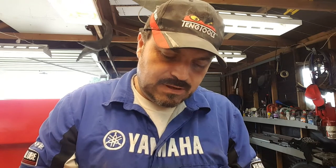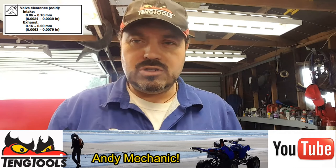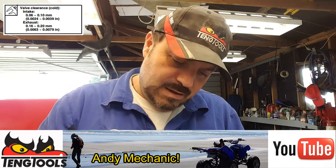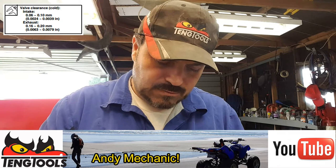And to use a standard feeler gauge, it isn't gonna happen. I think you saw me use these on the Yamaha Viking engine rebuild a few months ago. So I'm gonna set the clearance to what I call maximum spec, which is gonna be 0.1 because over time that clearance is gonna shrink down. So if we look on here, we have got, good old Yamaha, exactly 0.1 millimeters on a feeler gauge.